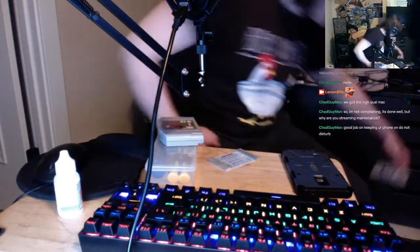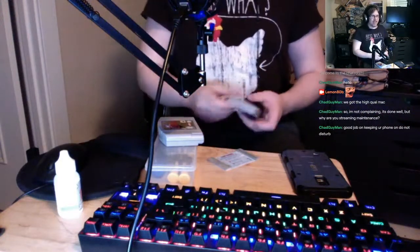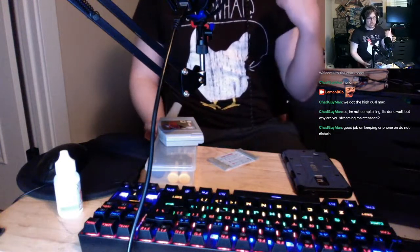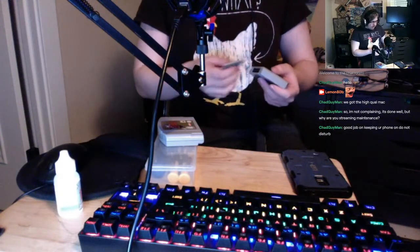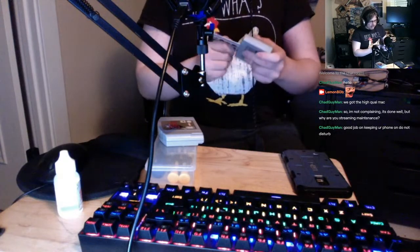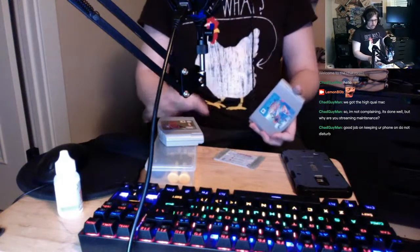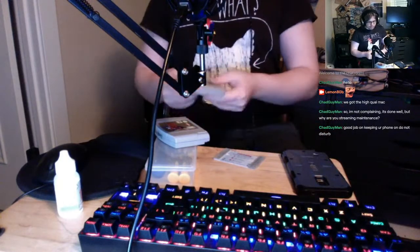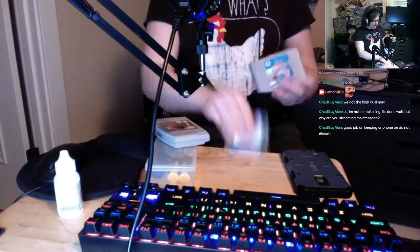Wave Race. Wave Race 64. The Japanese version. My N64 is region unlocked, which I didn't know until I tried to pop in Wave Race 64, and then I looked and I found out that was actually the Japanese N64 that just got region unlocked so that way I could play US. And how region locking works on the N64 is the software can run the games, but they have this little plastic thing for where the carts go. They have little plastic tabs, right? So they're in different places on each version of the system. And so if you just get rid of those, if you just sand them down or cut them off, you can play any game.